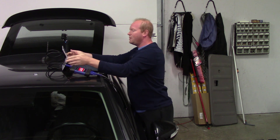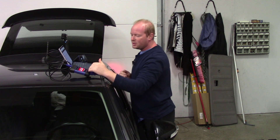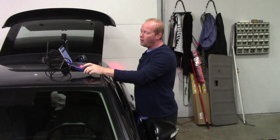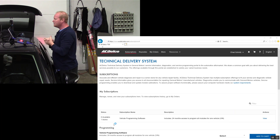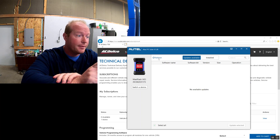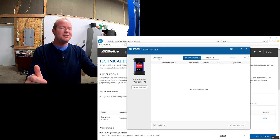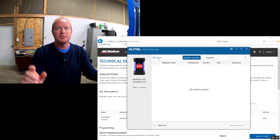Make sure that you have all your securities and firewalls turned off as recommended by the manufacturer. I am now connected to my Windows PC with my J2534 device plugged into the car. Our first step is to make sure that our drivers are up to date on our J-Box. We're going to open the Autel folder and the Maxi PC Suite. You hear it beep — that means it's communicating with the computer. You can see on the screen it says Maxi Flash JVCI. I'm going to click Refresh and it shows that all my updates are complete. I point that out because I have seen so many programming or communication issues solved just by updating the JVCI. Make sure it's current and up to date before you do any programming sessions.